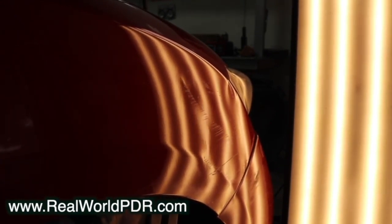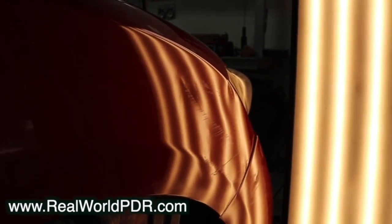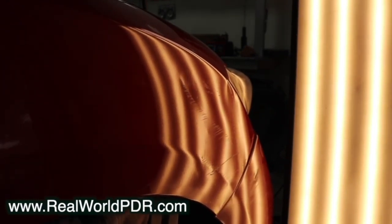If I were to loosen up or pick up a low, it's going to loosen up the crown. If I knock down a crown, it's going to shallow the low. The thing that causes the most texture most frequently in PDR are pushes. So I attack those crowns first to try to shallow everything up, because I don't want to be working against more pressure while I'm pushing. That's not always the plan of attack — there is no set-in-stone plan of attack. After 16 years, I can tell what crowns are going to be willing to work with me and when I should start pushing.